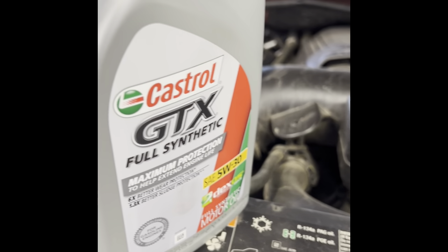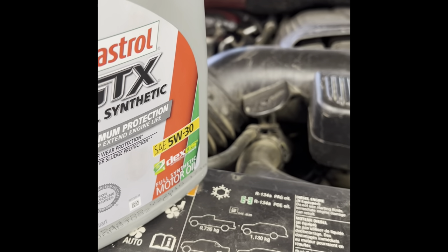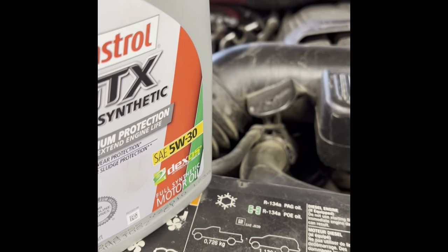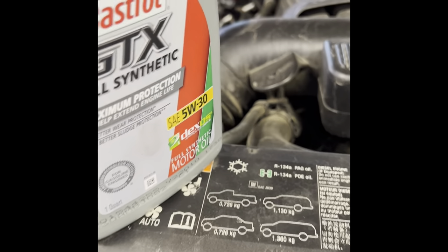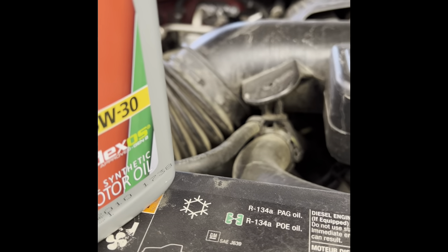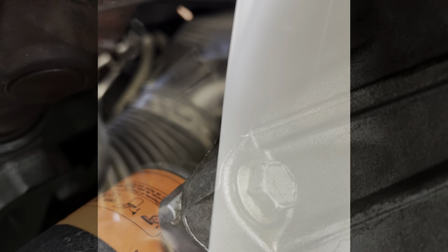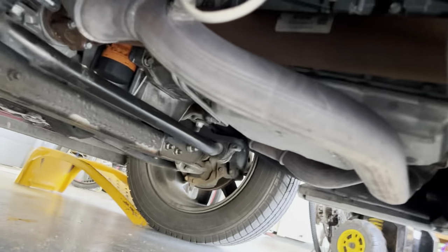Before you crank it up and test it, make sure you have oil in the engine - check your dipstick. I lost a lot of oil, probably a quart for sure, so I've got a quart here. Some people say when it's hotter it bleeds more. I let it sit until the engine cooled down because it's right next to the catalytic converter - it'll burn your hands. If you have nothing on your stick, add oil. On ramps it's kind of a guess, so once you get on level ground you can decide if you need to add more.